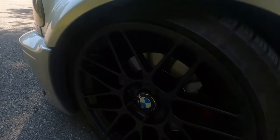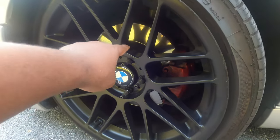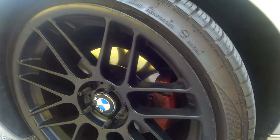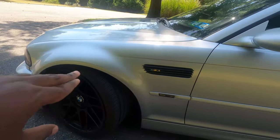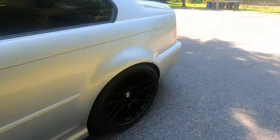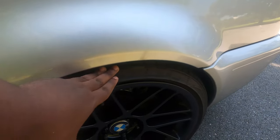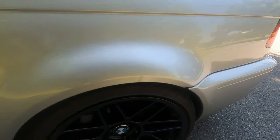As you can see, I have a 3mm spacer right here, although it is recommended to run a 5mm. I didn't have a 5mm and didn't want to purchase one, so I put the 3mm and it works. There's a really tiny distance between the shocks and the wheels, so I might actually get a 5mm spacer. Here on the back, I do have a 12mm spacer. I used to run it with 15mm, but it was rubbing on heavy bumps, so I changed it to 12mm. Now it does not rub anymore.